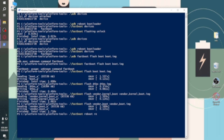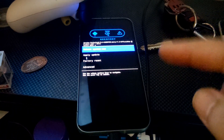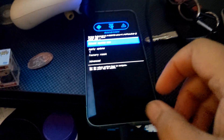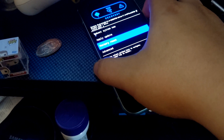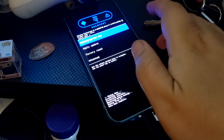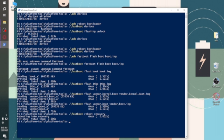Type `fastboot reboot recovery` and it will boot into recovery. Once you're in recovery, do a factory wipe reset — that will wipe all the data. From there, go back to terminal and you'll ADB sideload the custom ROM. In recovery, use the volume rockers to scroll to 'Factory Reset / Format Data / Factory Reset,' hit format, and let it do its thing. Then go back to terminal.